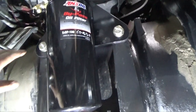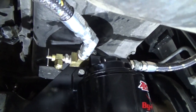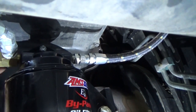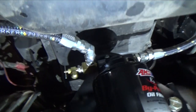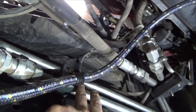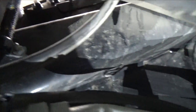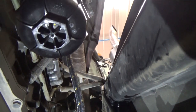Here's a shot of the bypass system. I used two existing mounts on that front differential and a piece of half inch plate steel — it goes up to about an inch below the oil pan right here on top. We've got plenty of room and it's good and solid. We've got a sample valve right here with a cap on it. That's the oil coming from the engine and that line comes down and goes right up to where that red alternator is — we attached it to a set of hydraulic tubes for the oil cooler.